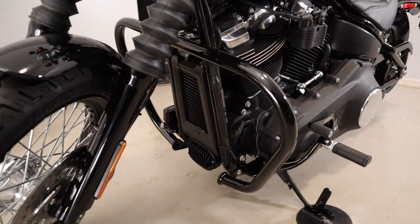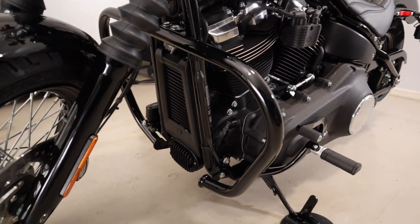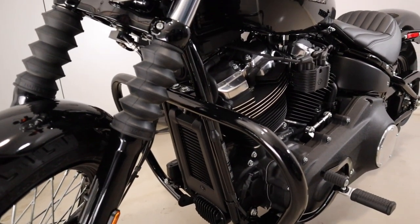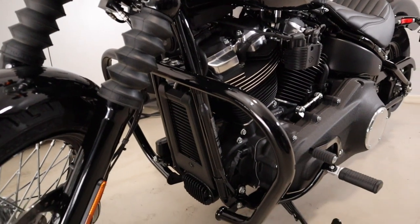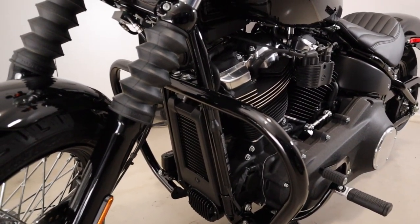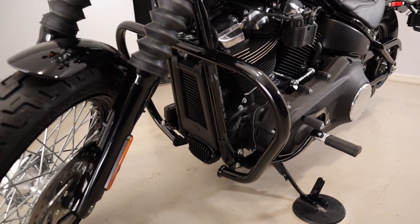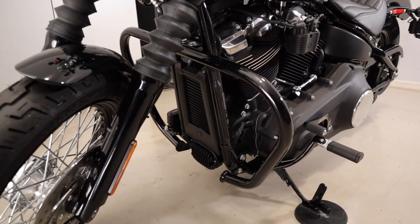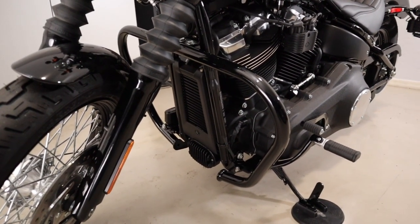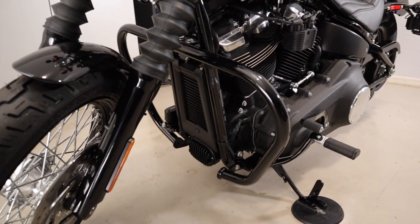That's it for today's install. All I did was hold the bar in place, lightly screw the bottom screws in, pivot the whole bar up, screw the top screw in loosely, and then tighten up the bottom ones — with the top bolt last. The instructions did not list any torque specs at all, and I couldn't find anything on their website either. I was trying to go off Harley torque specs, but those were actually too tight for the hardware included with this bar.